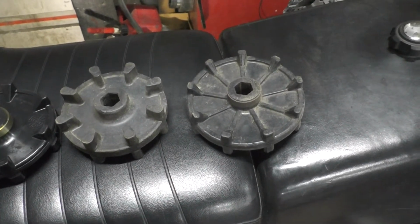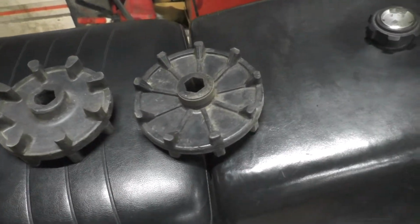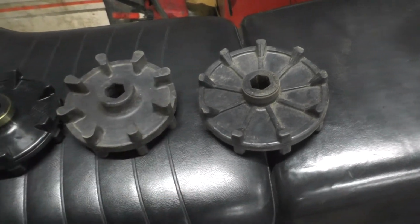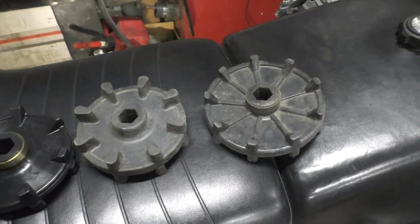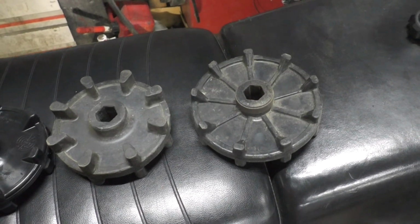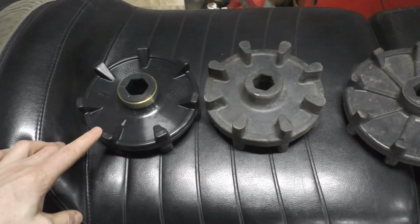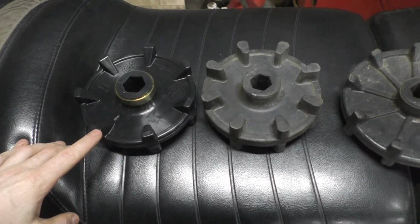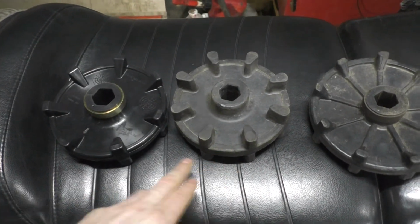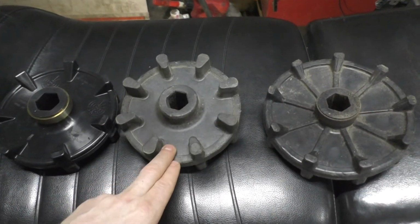But for now, to help gear it down and for clearance for the track, I needed to go to at least 8-tooth drivers in a 2.52 pitch to fit that size paddle. But since I only want wide tracks that have paddles more than 1.25 inches, or Skidoo, I got 2.86 pitch drivers, and it's a 7-tooth, but as you can see, a 7-tooth 2.86 is pretty much the same diameter as the 8-tooth 2.52.